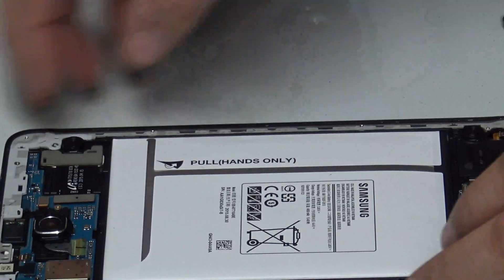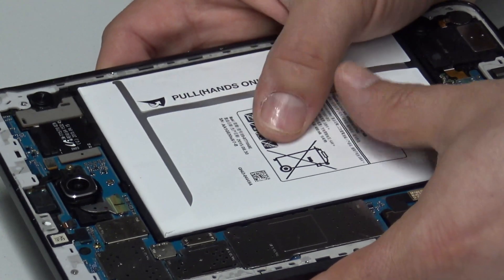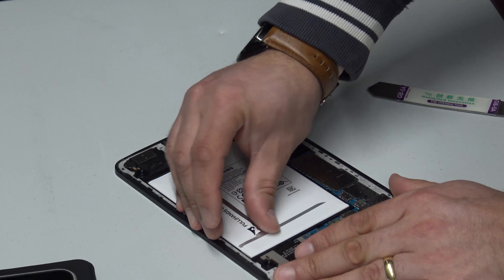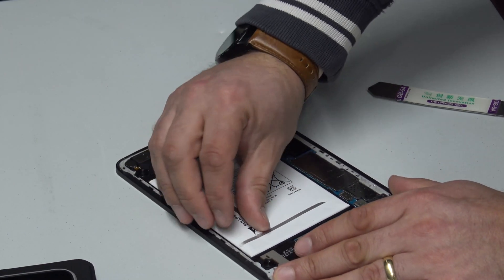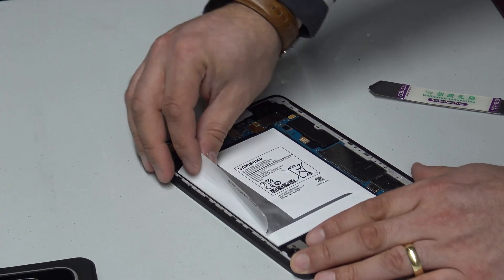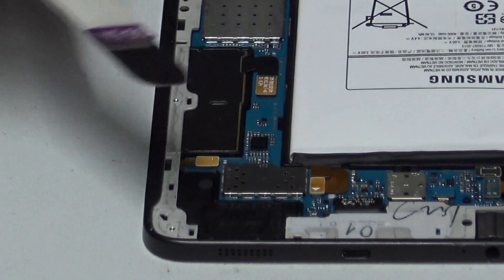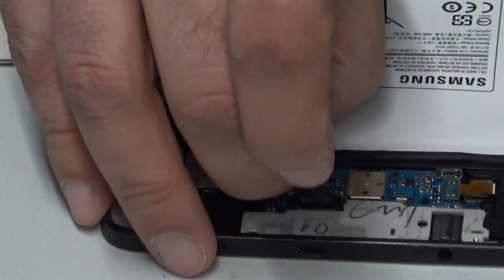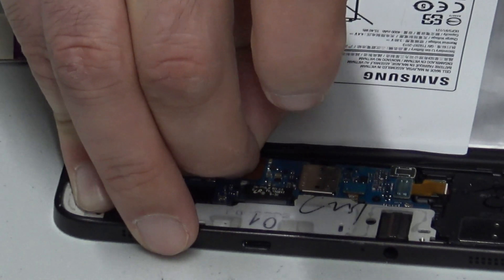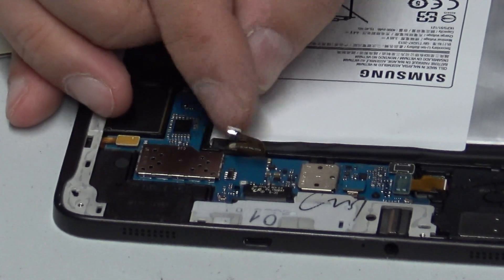This is the battery I mentioned — as you can see, it's quite squishy, it's full of gas. In order to remove this, what you have to do is pull up on this little piece of tape here. What I don't want to do is pop that off and end up ripping this connector off, so very carefully with my fingernails I'm just going to put my fingernails underneath this connector and pop up that connector — there it is, as if by magic. There's our little battery connector right there.